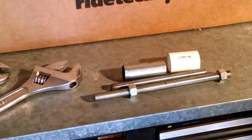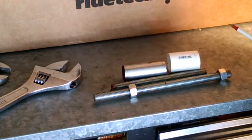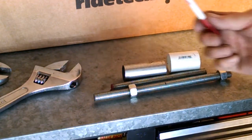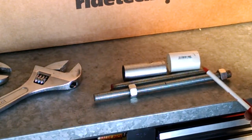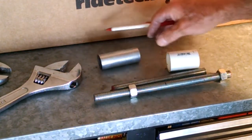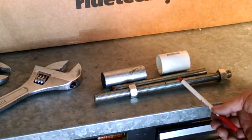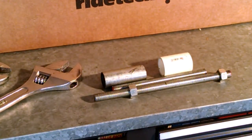This is how Froggy gets the old rubber bushings out. It's a little tool that I thought up — I won't say I invented it, somebody else has probably done it, but I did not see anybody do this before I did. This is a 5/8ths threaded piece off of a fence post, and this is a PVC connector for PVC pipe, and some nuts that fit the threaded bar. I cut the threaded bar into several different lengths depending on what length you need to get into the inside of the control arm.